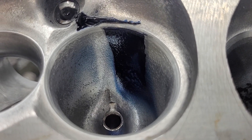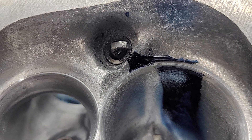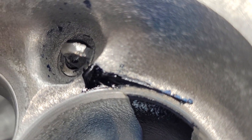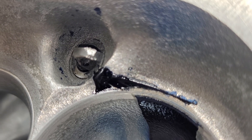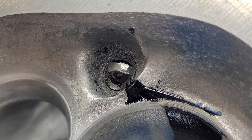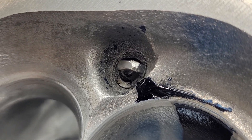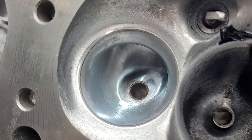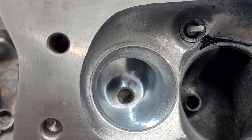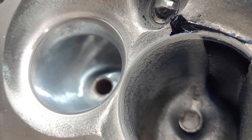It's kind of interesting how the dykem took a pretty serious turn towards the top. A couple guys said to take these lumps and bumps out around the plug — I've been thinking about it. If you take a look at the way the dykem hits, I'm going to say they're right. You see those spots of dykem on that lump right there — I think if we mellow that out a little bit more it might be better. I think we can afford to lose the tiny bit of compression we've got there. Polishing — the curves never look quite as perfect as my burr, but I spent some time on it; it's pretty close.